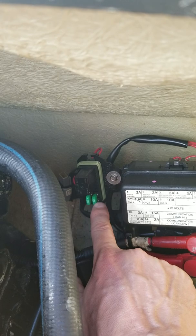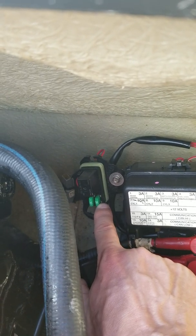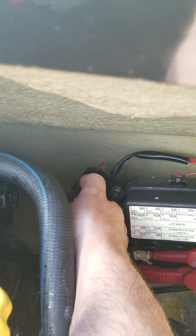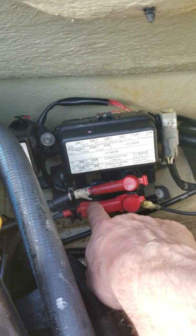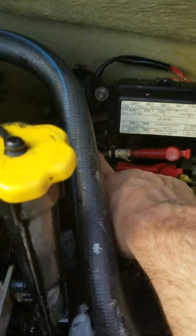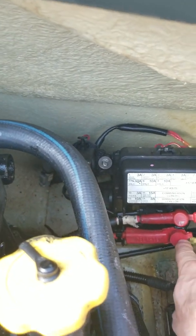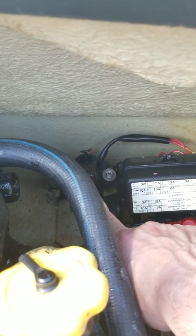The bottom part is your battery side. Take the negative from your voltmeter to the battery and touch the positive to the bottom of the fuse — you should see the battery voltage, around 12 volts, with the motor off. The next step involves these two wires here. They were embedded into the bottom plastic piece that connects directly to the battery. I tested with the voltmeter and realized I was only getting 12 volts while running — it was running less than 12 volts, causing the warning to go off. But if I'm getting 15 volts from the rectifier, why am I not getting it here?